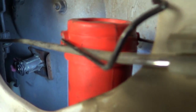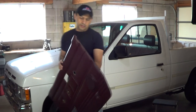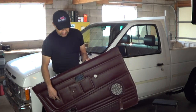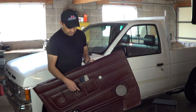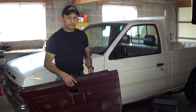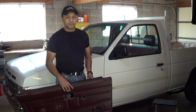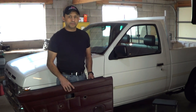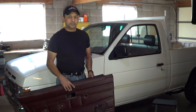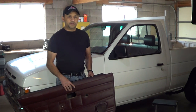Finish by installing the door panel back on. If any of the clips that fastened the panel to the door broke off, you'll need to install new ones. Then install the window crank handle, the armrest and handle, and the plastic molding around the door handle. As you can tell, this was not hard to do. The biggest issue was that we couldn't find the broken clip at local auto parts stores and had to go to the dealership, but aside from that it all went very smoothly. If you have a truck with a similar problem, it's very likely the same cause — hopefully this video helps you repair it and lock and unlock your doors with your keys again. Thanks for watching and see you next time.